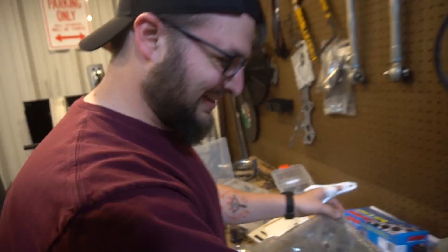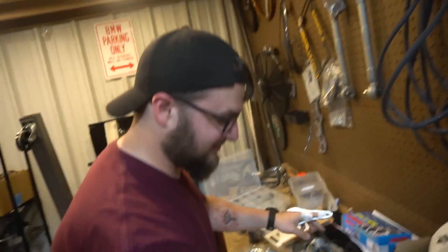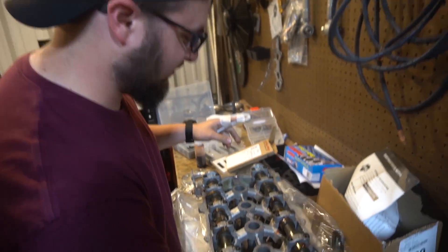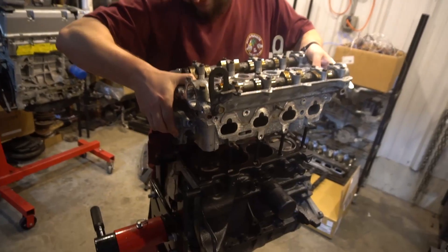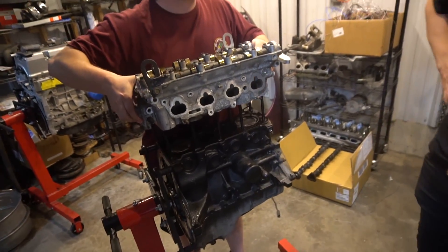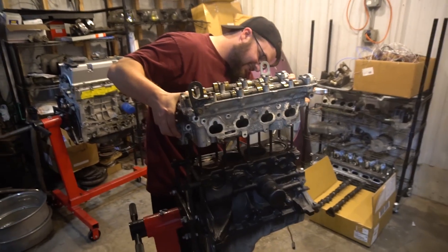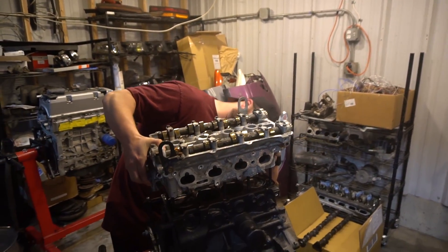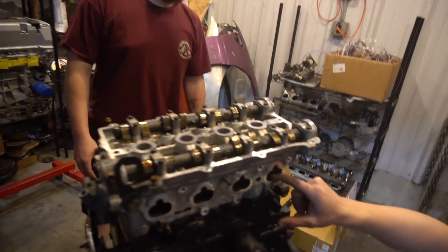This thing has been freshly sealed for months. We can do this with the cams in — how cool is that? We're doing the head install like a carnival ring toss. We've got a Cometic head gasket in there. RJ lowers the head down — once it got lined up it just slid all the way down. We should do a little porting and polishing on these while we're at it.